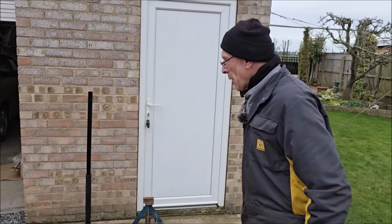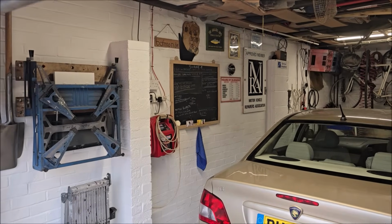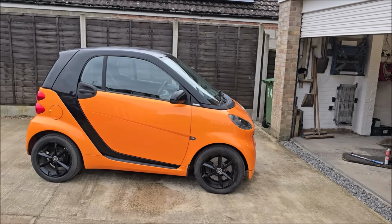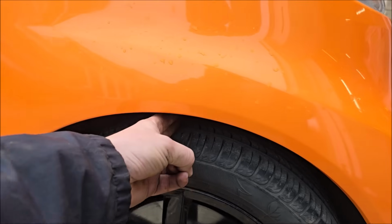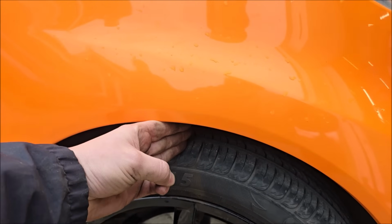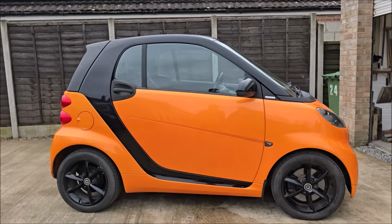All the way round. Because of that broken spring at the rear? Yeah, let's hope not. There was a big bang, wasn't there, when I jumped in it. 581 to 57. So we've actually gained 20 mil to 2 centimetres. We've gained nearly 3 centimetres each side. Sits a bit better now. Remember before we started, I was struggling to get 2 fingers in. Now I can get 3 fingers in. I think she sits better now. She's not looking low at the front.